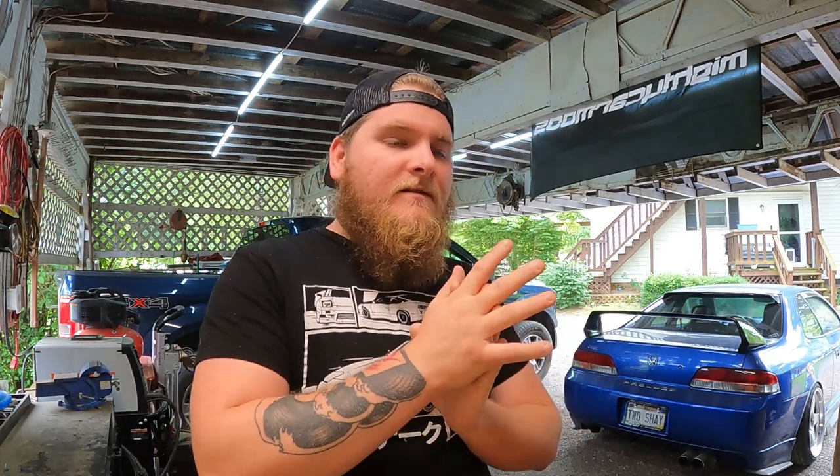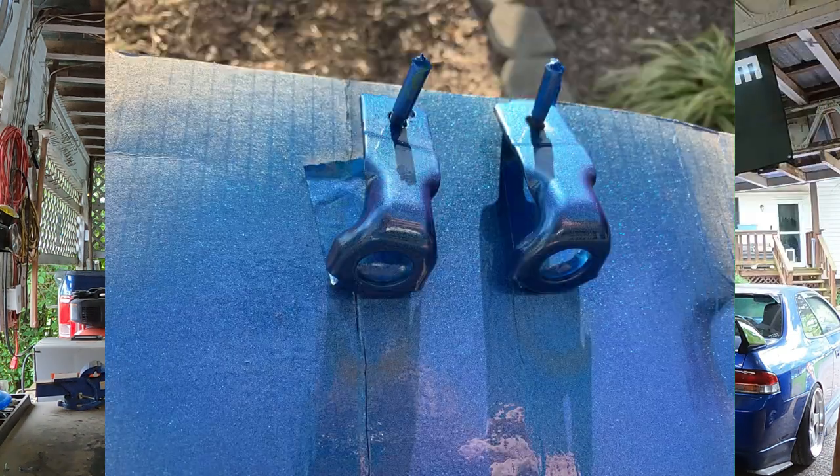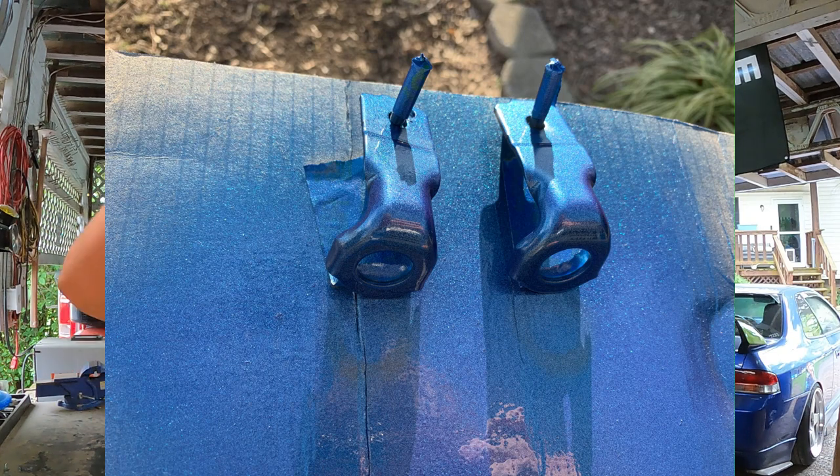For the upper folding part, the top of it's not secured the best yet. Actually my amp is what's kind of holding it still. The way I did it: if you take your folding rear seat out, unbolt the top part and pull it out. There are going to be two metal brackets — take those brackets, flip them around, put a 10 millimeter bolt through, and weld like that. So my seat delete piece is secured almost the exact same way that your seats are. I can fold it down, which I'd like to be able to do in time, but I still need to secure the top.